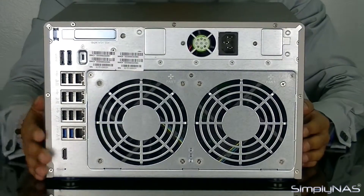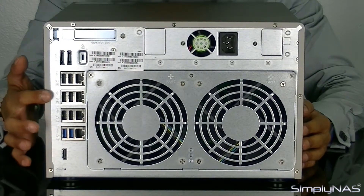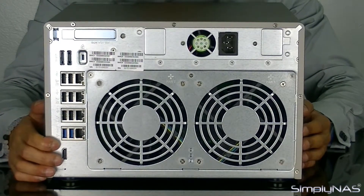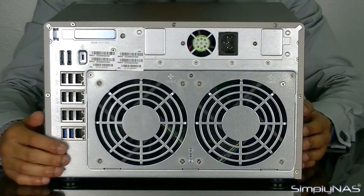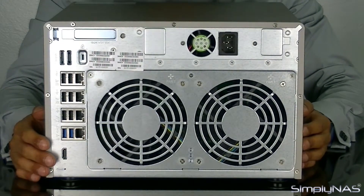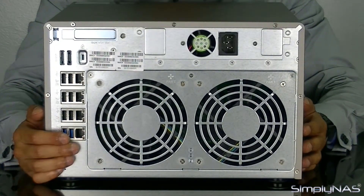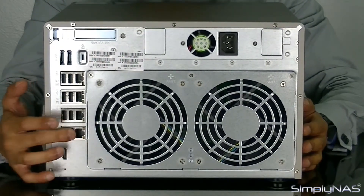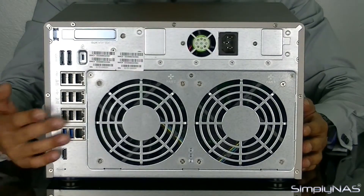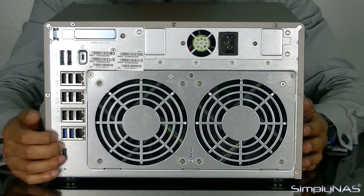You've also got your USB ports here. QNAP gives you a variety of USB ports: six USB 2.0 ports and USB 3.0 ports at the back as well. The USB 2.0 ports are generally utilized for keyboards, mice, and USB monitors — allowing you to log into the NAS without needing network access. The USB 3.0 ports are typically reserved for either external hard drives or, as we mentioned earlier, the expansion units, since USB 2.0 is just too slow for an expansion unit.